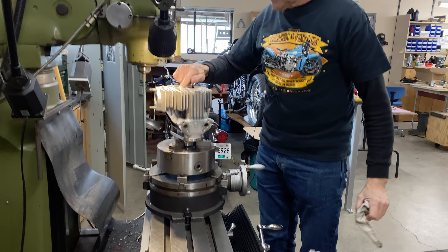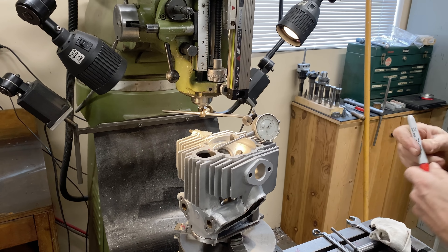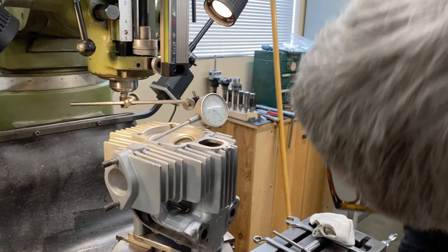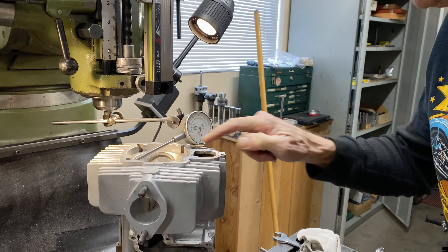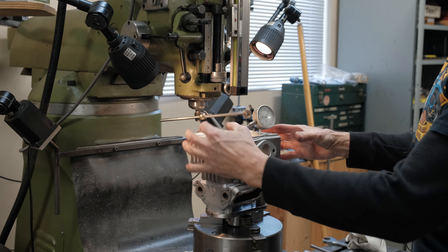We're mounting the fixture onto the top of the cylinder head. Last time I used this was over 18 years ago - it's been sitting upstairs for almost two decades. I think I did maybe three heads with it in total. Some people will ask why not do this in the lathe - that's a valid question, but this whole thing is only held by three 6mm Allen screws, so it's not exactly held hugely well. When this thing is spinning and if the tool bit catches and moves, there are too many variables, so we're not doing that.